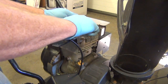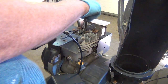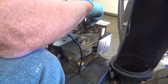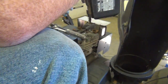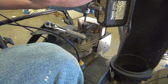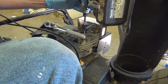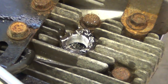What I ended up doing was taking the tool and threading it into the cylinder just to see how far down it would go. Turns out it only went down a little ways before it bumped into the top of the engine. So in the end I was forced to cut the small end off the tip of the tool, which was like a thread chaser for the original threads.